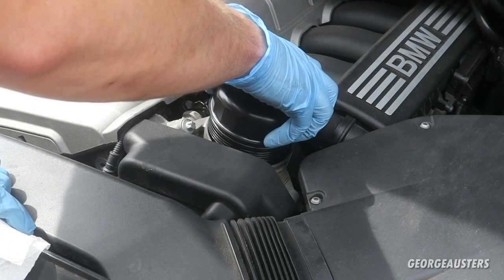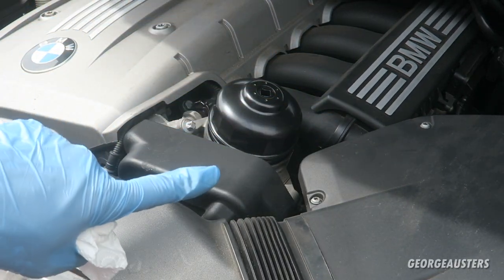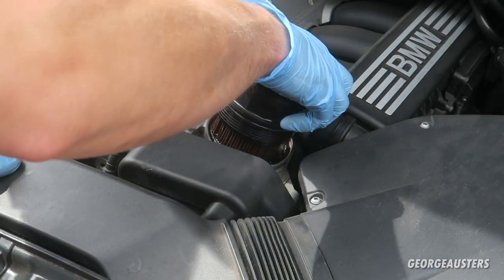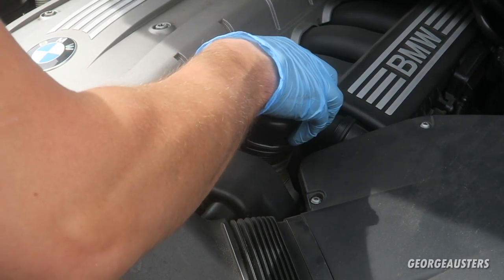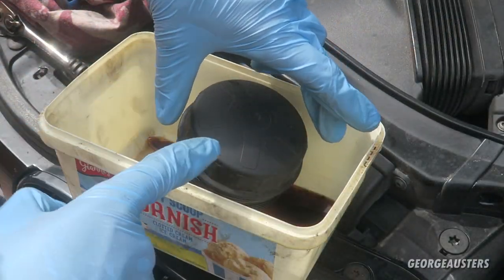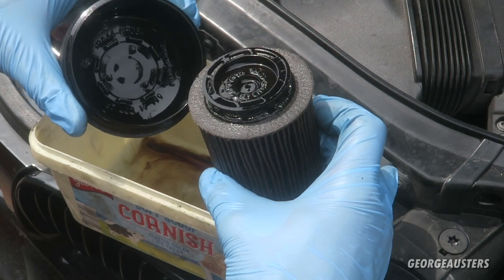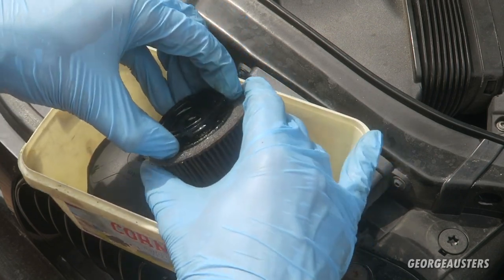I'm not going to remove this fully yet — I'll just let it drain down a little bit first so oil doesn't go everywhere. I like to do the oil filter before draining the oil, because if you drain the oil first, put the sump plug back in, then do the filter, the dirty oil from the filter drains back into the sump. On first inspection it doesn't look too dark. I'll lift this out and remove the filter from the housing cap — it should just pull out. Keep the cap and also this center piece — do not throw this away.